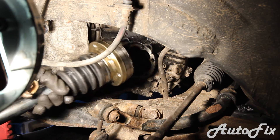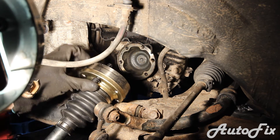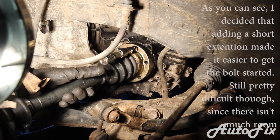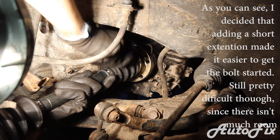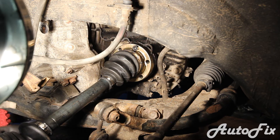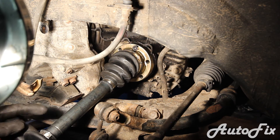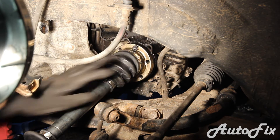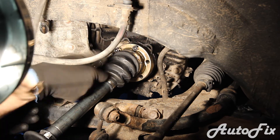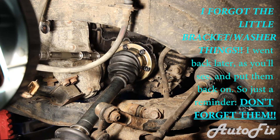Here's the finished product with grease applied. I'm going to get one of the new bolts and put it through so that when I get the axle on I can start threading it right away - that way I can hold it in place. Once the first one's on it's a great moment because this thing is pretty heavy and it's really hard to hold it, tighten the bolt, match the holes, and keep the gasket on at the same time. Now let's continue with all the other bolts - they get torqued down to 48 foot-pounds.